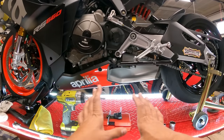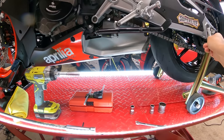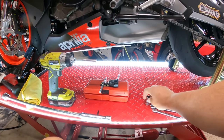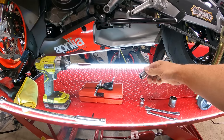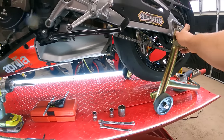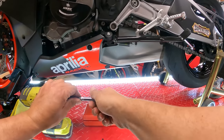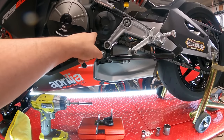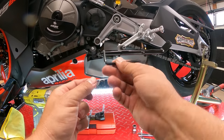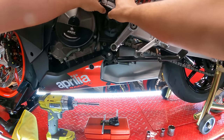So we've got our tools all lined out here. We've got a 13 millimeter to break the chain loose and the adjusters loose, along with a 10 millimeter. We've got a 12 millimeter which is going to be for our sprocket, a 14 millimeter for our sprocket nuts in the rear, and then a 25 millimeter for the axle nut. This is an 8 millimeter for the three bolts for the cover. You're also going to need a 5 millimeter to remove the nut and remove the shifter.